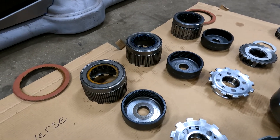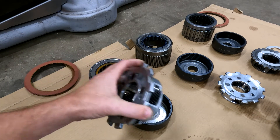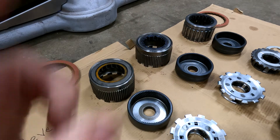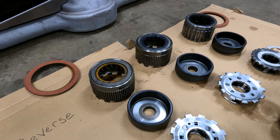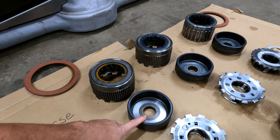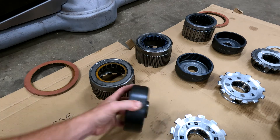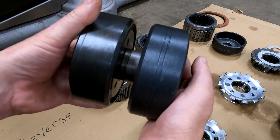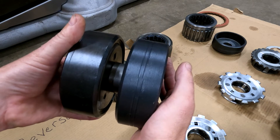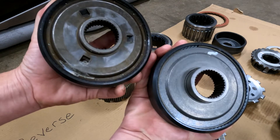The low reverse ring gears — as long as you've got a four-pinion rear planet, your six-pinion rear planet will fit into the stock C6 ring gear. The only difference between reverse ring gears is the distance, which has a little bit more meat to go into the back of the transmission for better support. Other than that, pretty much the same — and no bearing.